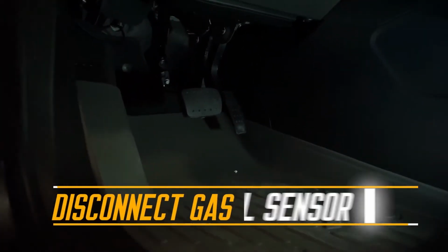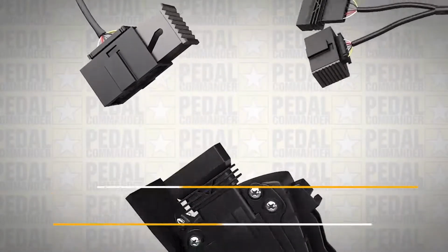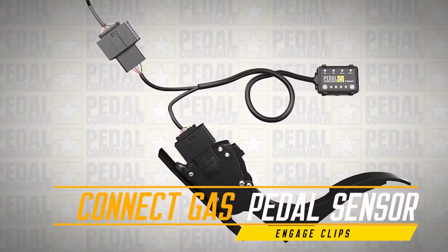You will want to unplug the connector on the gas pedal, plug the Pedal Commander into one side, and plug your existing cable that was there into the other side of the Pedal Commander unit, and you are good to roll.